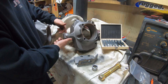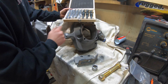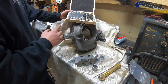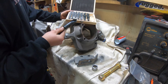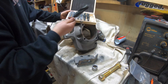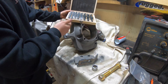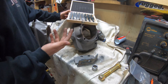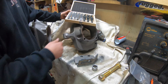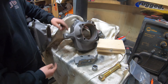Next it's time to drill this out to one inch. I went on Amazon looking for a one-inch drill bit and they were all pretty pricey, then I stumbled across this kit - I'll throw it in the video description. I really recommend it because it starts at 9/16ths and goes up to one inch. These drill bits are not the best - I'm thinking I'll only get two or three uses before they're completely dull, but I got the whole kit for about $25. We can't just grab a one-inch drill bit and go straight through - we have to work our way up getting bigger each time. At $25 for the kit versus the cost of a single one-inch drill bit, it's actually cheaper to get the full kit. I'll put this in the video description.